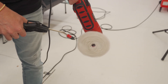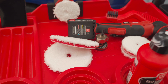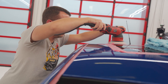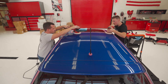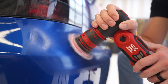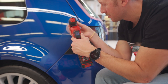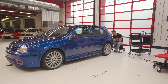As you work your way around the car and use more and more abrasives, you're going to clog up that microfiber facing. So it's important to consistently clean the pad facing as you work your way around the car to stand those fibers up so that they do their job and actually cut and remove defects. For tight spaces, we introduced the Boss Hybrid Micro Polisher, and you can see we're getting some good results pretty quickly. After attacking the majority of the flat panels, we did find a couple of other areas that were more damaged than others, and we treated them with the same process of microfiber pad and FCC.